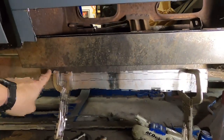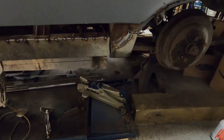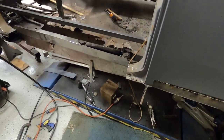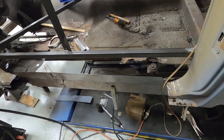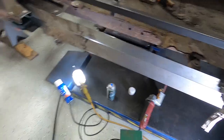The new piece has all been fabbed already and clamped in place — it's going to be welded all the way along the bead on top and spot-welded along the bottom as well. We just kind of did the patch for this area here. This is still just tack-welded — I've got to go final-weld that, then put the rocker top all the way in on this side. I've got a lot of cleaning to do yet and a lot of welding and grinding, so I've got to get back to work.